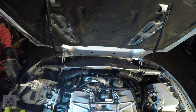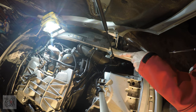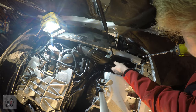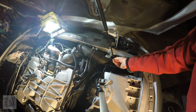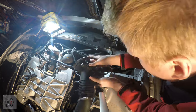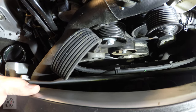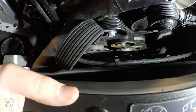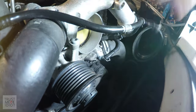Next we need to remove the right-hand air intake intermediate pipe to get it out of the way so we can access the idler for the supercharger. To take off the supercharger belt, hook on to the idler down there with a 3/8-inch breaker bar, give it a yank, and pull the belt off. Next we take off the serpentine belt at that idler over there. Then remove this water pipe and the idle tensioner.